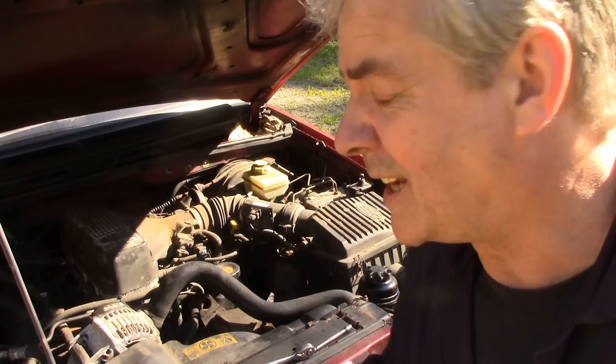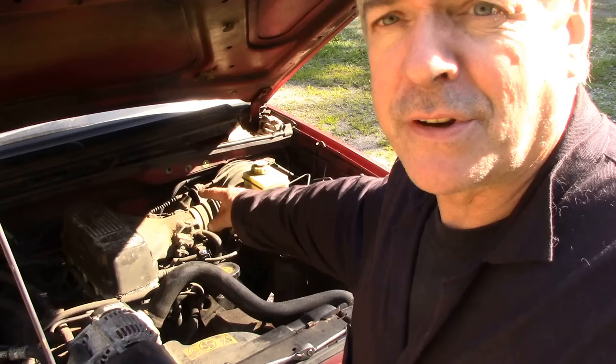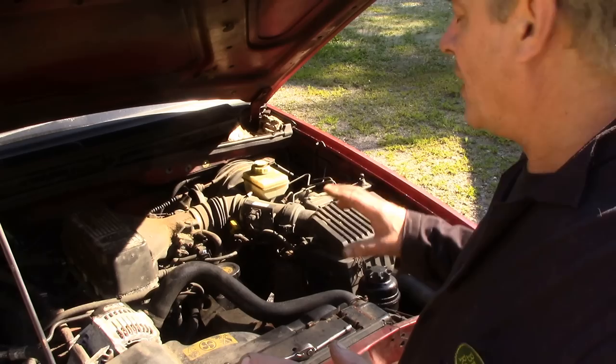One of the problems we've got with this is it's got a high idle, which I don't really like. So what I'm going to do is some very simple things that are going to cost next to nothing — some carb cleaner, but that's about it. We're going to take off the idle control valve and the throttle positioning sensor, we're also going to take off the mass airflow sensor, and we're going to clean out the butterfly valve of the air intake.